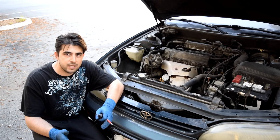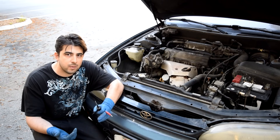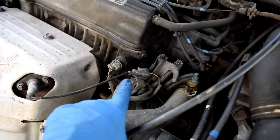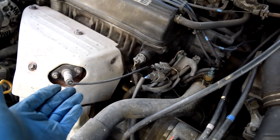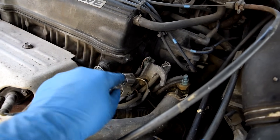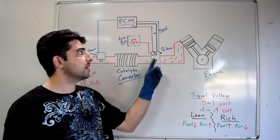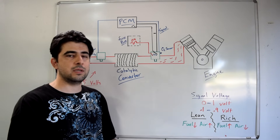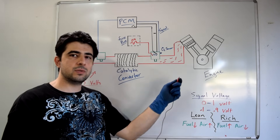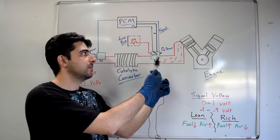If you have a check engine light for an O2 sensor heating circuit short or open, and the resistance checks out, then check the wiring harness from the PCM and junction box. Disconnect the harness connector, start the car from a cold start — make sure it's been sitting cold, otherwise the PCM may not command the heating circuit on. Probe the harness-side connector with a test light clipped to battery ground. One wire should give you 12 volts. If not, check the fuse in your fuse box, and if that's good, you may have a wiring problem from the fuse box.